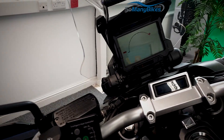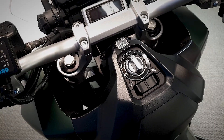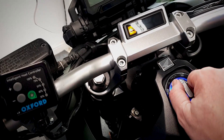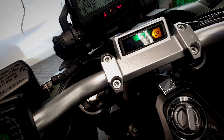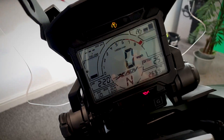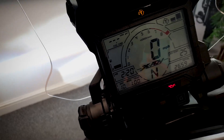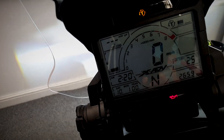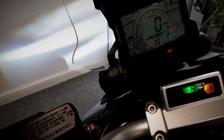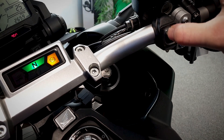This is keyless ignition - so long as you've got the keys in your jacket, they work off proximity. If they're in range, press down and it switches the ignition on, then turn the key. The mileage at the moment is 2,659. At the top you can see the T symbol, so it's in traction control mode two. Pressing this button changes it between one and two on the traction control. There's also a switch for your additional spotlights on the front.